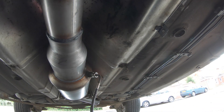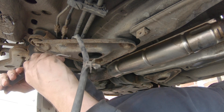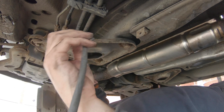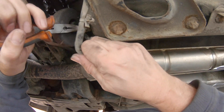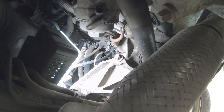Now we've got to do the ones as it runs up over the engine. It goes over that plate there and there's another clip which I'm just removing — again pushing the tabs in and then you can just push it up and release the cable. There's another sensor just there, and out of shot there's another sensor a bit further up. Pulling the old cable through — if you look where that red cable is, just to the side of that red cable is where the plug is where the sensor plugs into.